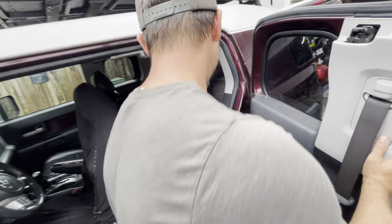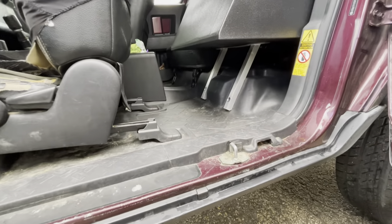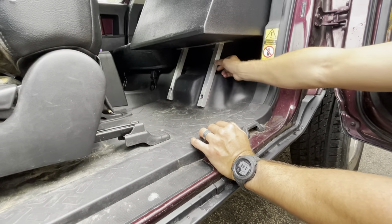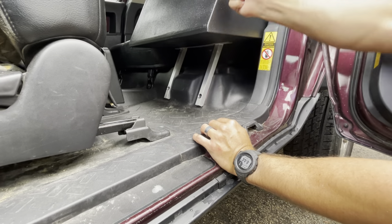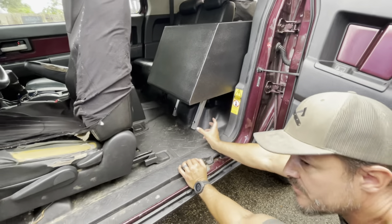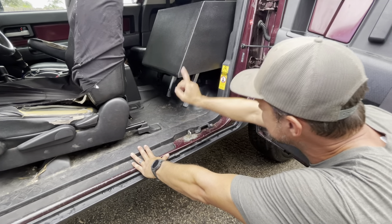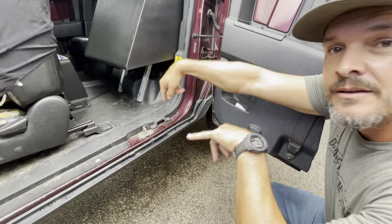This could be a world's first FJ Cruiser floating drawer system — if it isn't, go ahead and post a link below, I want to see it. What I ended up doing is making these custom brackets out of one-inch aluminum and tying into the factory seat mount locations to give support to the actual drawer system. The back part is supported by the mounts where the seat was actually bolted to the vehicle. This thing is bolted to the floor in four spots, and also to the other main drawer in two spots, and then the main drawer is bolted down to the factory mounting location in four locations — definitely nice and secure.